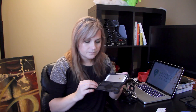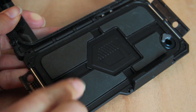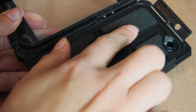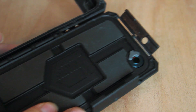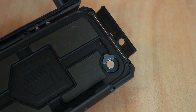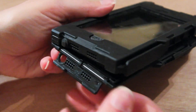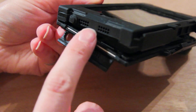The back piece is actually quite interesting. It's the same type of hard polycarbonate plastic and it has three latches that snap onto the front piece of the case. The back piece has elements that are foam — a shock absorbing or impact absorbing type of foam. When you press into them, they're quite soft, and there are four of them, all exactly the same. Another shock absorbing foam piece is by the lens opening, and it's just on one side — actually on the left side of the lens. The three latches: one opens fully and contains the hole for the knob from the front piece, and still contains the little holes that correspond to the holes on the front piece.